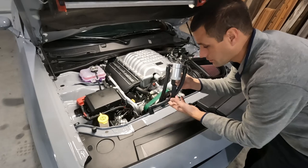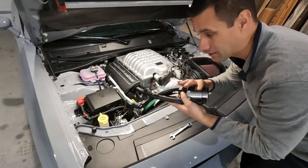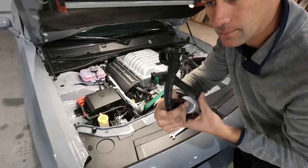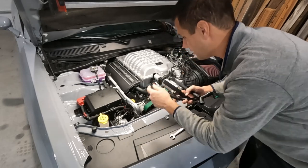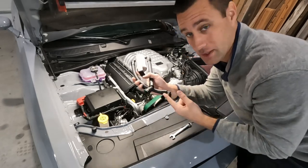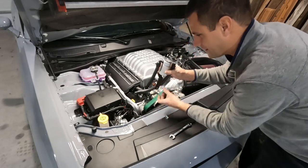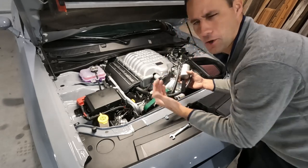Here is our J&L oil separator — it's a really nice setup. One thing I really like is the factory-style quick disconnects on the ends. These evap emissions and breather lines from the factory use this same push style that spreads the two tangs apart so you can pull it off. That looks a lot more OEM than a hose clamp or a cheap fitting. He also offers a couple of color options — black anodized or clear anodized. We went with clear anodized, which looks cool with the silver supercharger lid and black bracket.